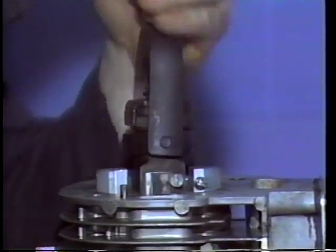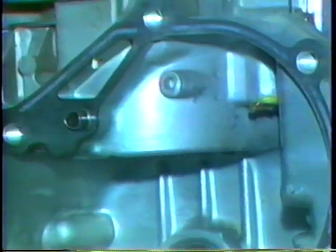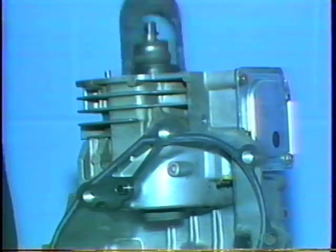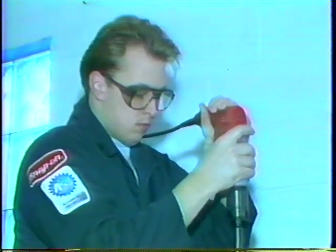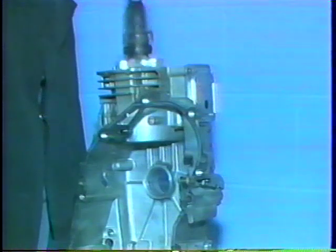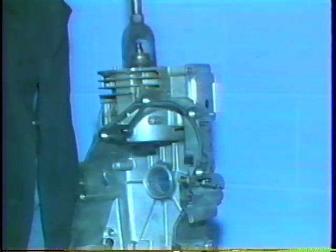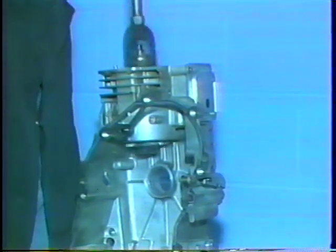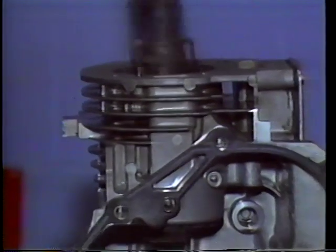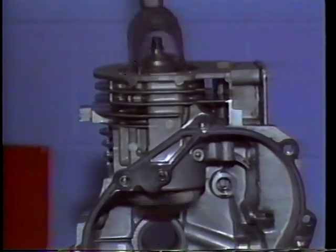The hone must be adjusted outward until the cylinder cleans up. To avoid injury or damage to the hone, do not let it slide out of the cylinder too far. Only allow the stones to extend about an inch out of the cylinder so that they don't catch in the crankcase or extend out the top of the block. Also, never overhone the cylinder or it could be machined too large. Only hone enough to clean up the surface.